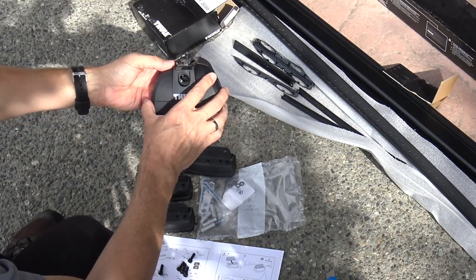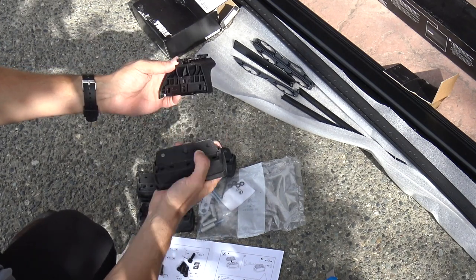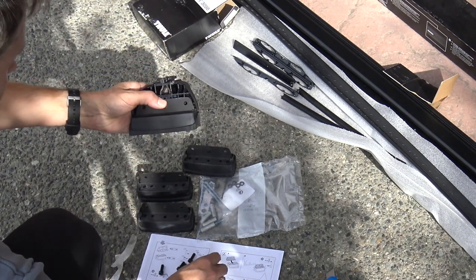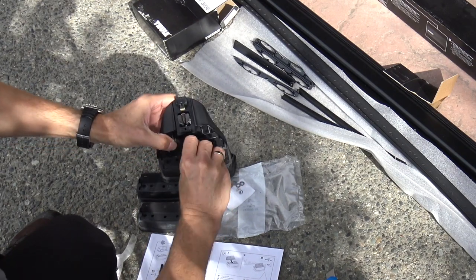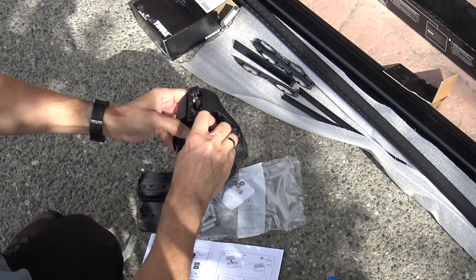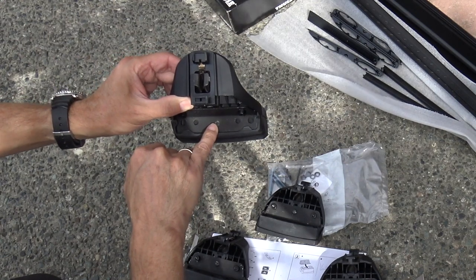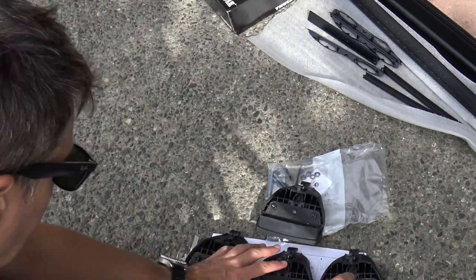Now if you look at the tower and remove the cover, you see two holes that correspond to the back of the tower, where there are two threaded areas that you're going to thread into. That's where the 16mm bolt goes. So we've got all four towers done. As you can see, that's where the bracket fits in — you've got your two bolts — and the main post that attaches to the car is going to come through this part. Now let's check the instructions for the next step.